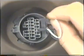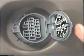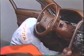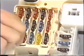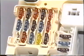Code 14 is displayed. When a diagnostic code is displayed, you must check if it corresponds to the particular trouble you are checking the system for. To do so, remove the probe wire from terminals TC and E1 of the TDCL and cancel the diagnostic code once. You can cancel it by removing the ECU B fuse from the junction block number 1 for 10 seconds or longer with the ignition switch turned to the off position.